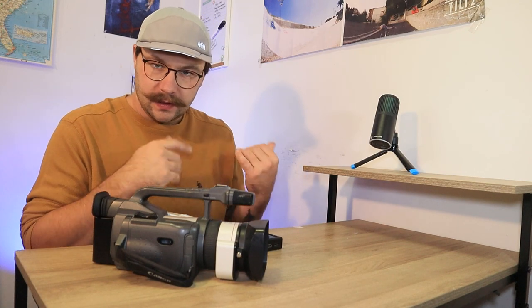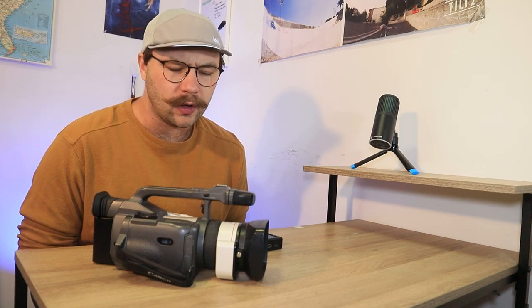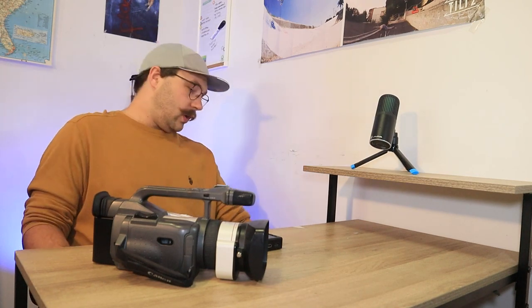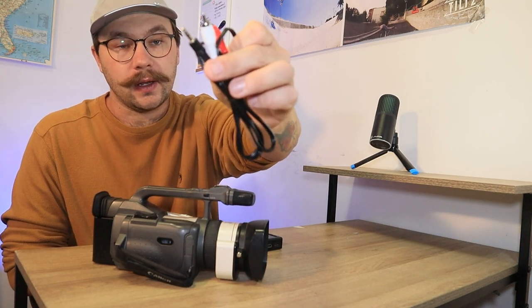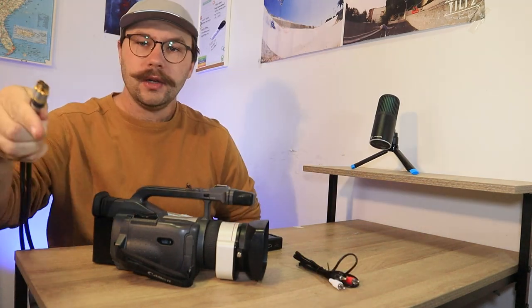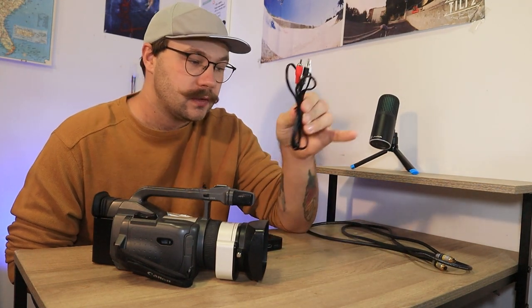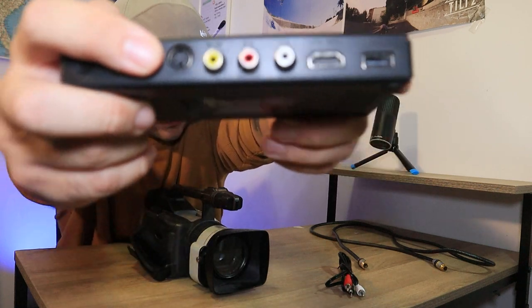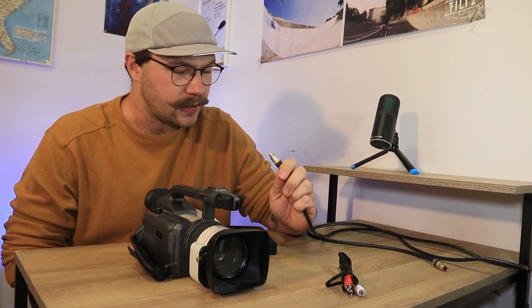Let me show you how to set this guy up. I'll show you how to set it up with the S-Video function, just because I don't have a camcorder right now that takes the AV cables. I'm showing you the S-Video portion of it because I think a lot of people are a little more confused on how to set that up. What you're going to need is your audio cables and an S-Video cable. The reason you need the audio cables is because S-Video does not have audio — it's just video. So you'll need those to go along with it. This is your S-Video port here. You want to find that same little port on your camcorder and plug this in.